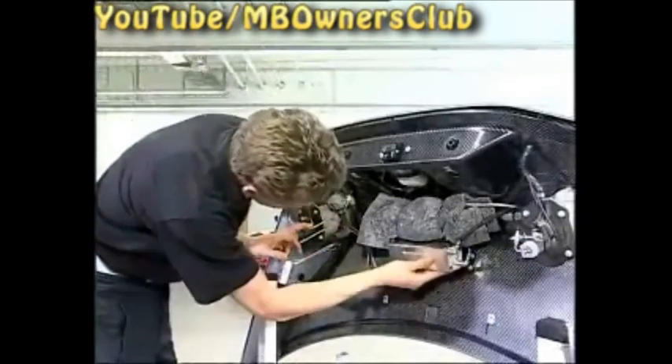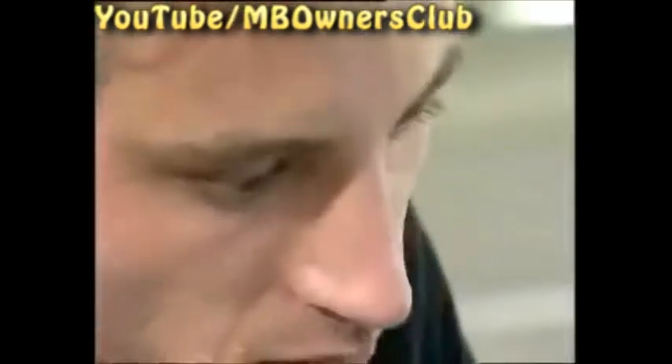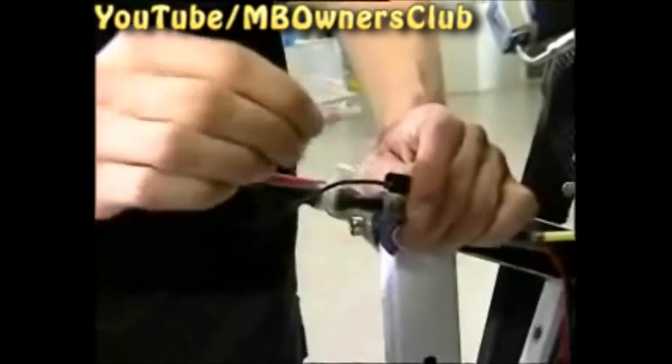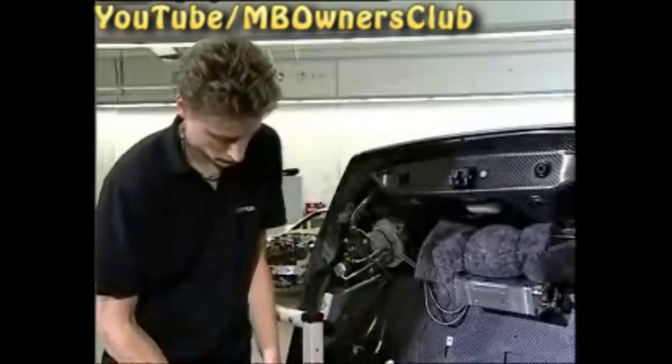Now check the hydraulic lines of the cylinders. The hydraulic pumps and lines are not leaking. Next, examine the plug connectors at the hydraulic pump motor. Remove the cable ties and push the sleeve back. Afterward, pull out the plug connectors and attach the multimeter. Since our rear spoiler is run in, the micro switches have continuity, so everything here is okay. That means remove the entire hydraulic unit and exchange the hydraulic pump.